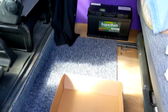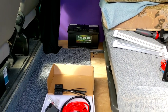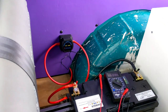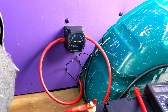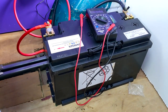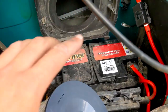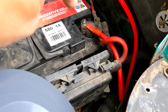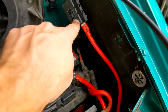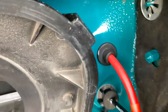I'm going to crack on, scratch my head for a bit, have a coffee, and we'll get on with it. Right, so we've got the leisure battery and the split charge relay all wired up — the red light is on the split charge relay. I measured the voltage on the battery: it's 12.4 volts. I did move the pollen filter box just to make access a bit easier. We've got a live from the battery which loops around up into a fuse — an 80 amp fuse.